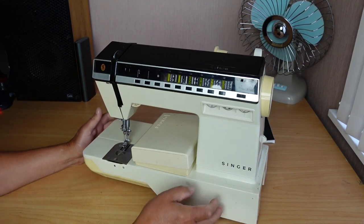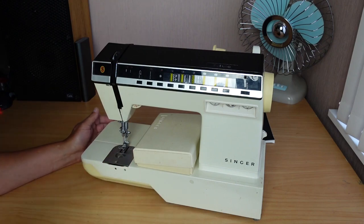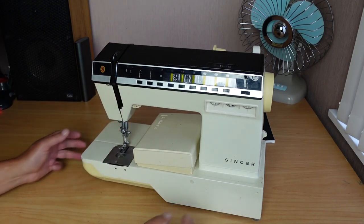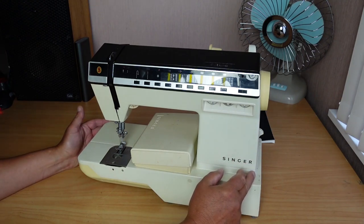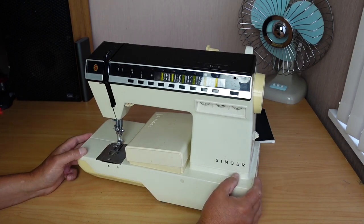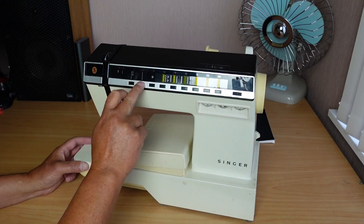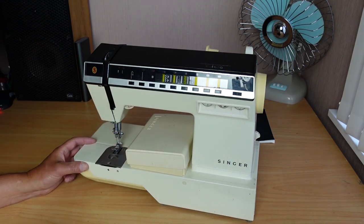The plan today is to go through and assess some of these machines. This is probably the better one I've got by just visually checking over them - I haven't really done any in-depth tests. I've actually tried this machine and it's working, although I had it plugged in the other day and it started making a funny hissing sound. I think that might be a capacitor starting to fail down in here. I'm not all that familiar with these machines, but I'm going to have a look for that capacitor, see if it is causing that issue. Also there's a problem with a couple of these buttons - the straight stitch and the reverse stitch - they don't respond very well, we've got to push them very hard. And if I get time, I'd like to quickly bring each machine onto the bench for a quick assessment, and then maybe I'll do other videos on those as we go.